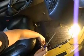The main objective right now is we're just trying to feed the power wire through, so you don't really have to take everything completely out of the car. Okay, so we're going to take the seat out, and you have to remove these clips. We already got one clip out. When it's in, you just take a screwdriver and lightly pop it up. Just pry the head up, and then it'll come out. And this will slide forward, just like that.